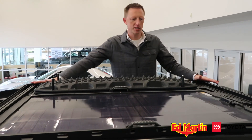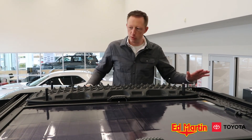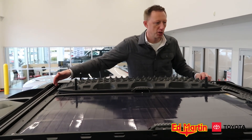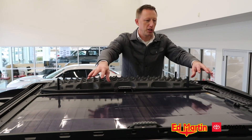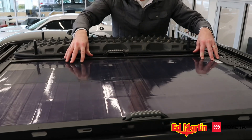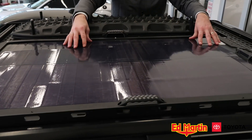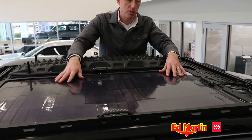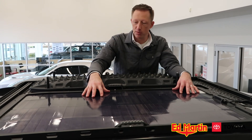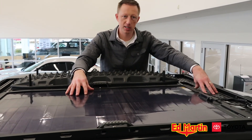Up on the roof rack we're looking at a Westcott Designs three-quarter inch roof rack. It's an all-aluminum modular roof rack that uses 80/20 bars, so it's easy to mount accessories to. This particular solar panel is a Yuma 100-watt flexible solar panel. You can apply it, it rolls up. We wanted it to be perfectly flat so we mounted it to the actual platform on the Westcott Designs roof rack.